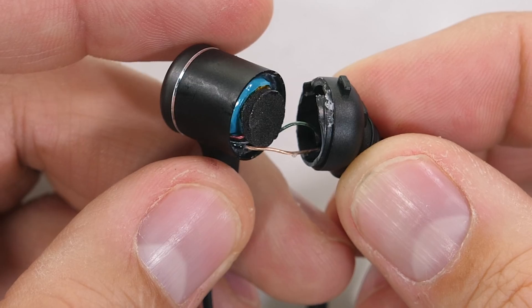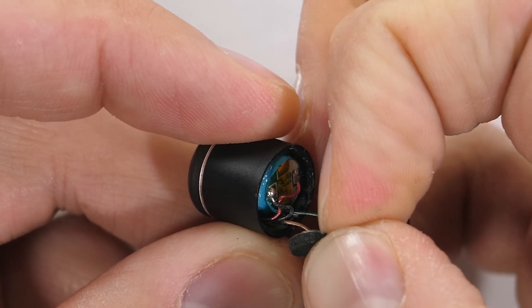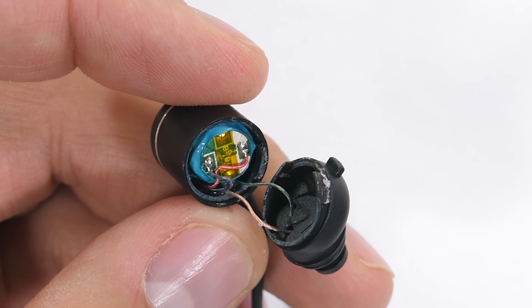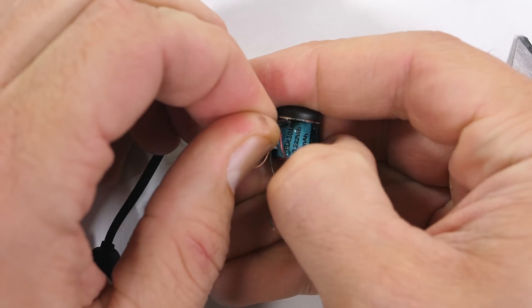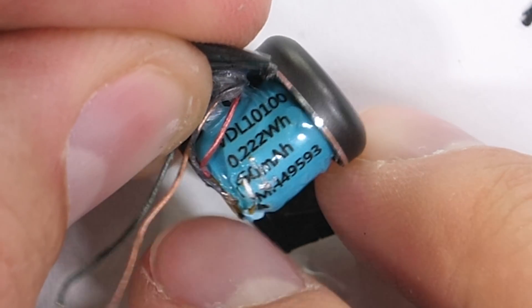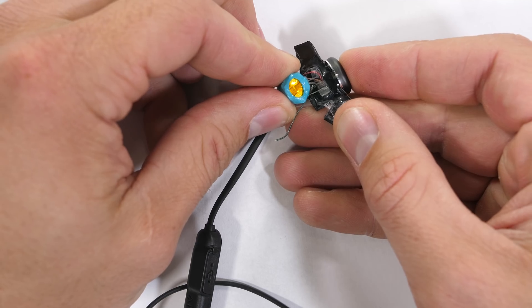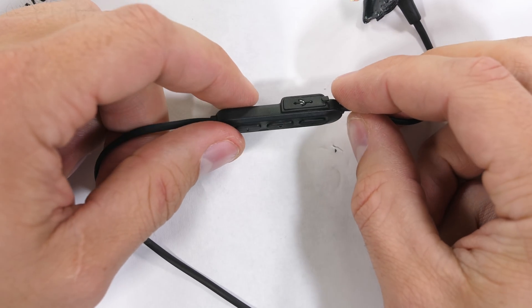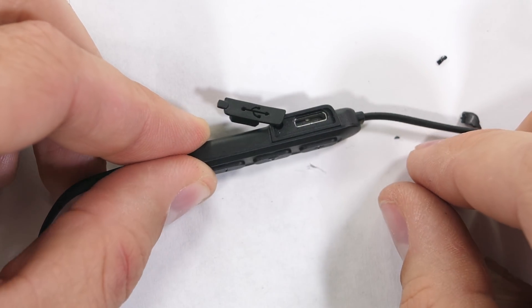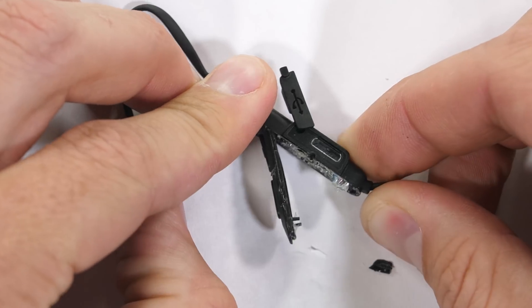The Soundcore Spirits are the smaller round in-ear headphones with little bits of rubber that conform to the insides of your ear. Taking this review to the inside, we find some sealed plastic, which is good for waterproofing. Then we see the internal rechargeable battery. Taking special care not to puncture it, I'll slice through the outer plastics to reveal the blue 50 or 60 milliamp hour battery tucked up inside. The micro USB charging port flap is there to help keep liquid and dust out.